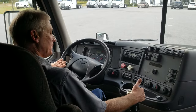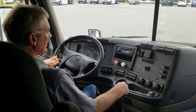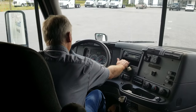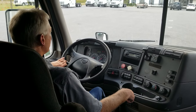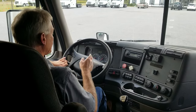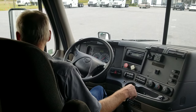From there I'll begin a tug test. I'll place the truck in first gear. I'll release the tractor brakes and I'll gently tug on the trailer brakes. On the parking brake, release the trailer brakes, and I'll gently tug on the tractor brakes. Then I'll release both brakes. I'm going to check my service brake by slowly moving forward about five miles an hour, apply the service brakes to make sure that the vehicle stops in a straight line and does not pull left or right.